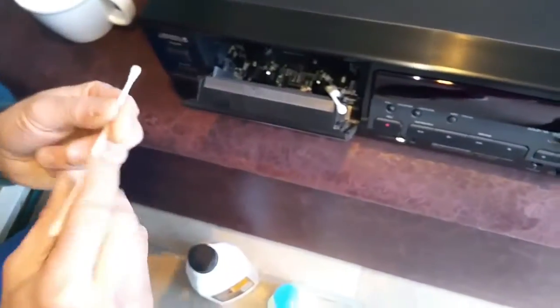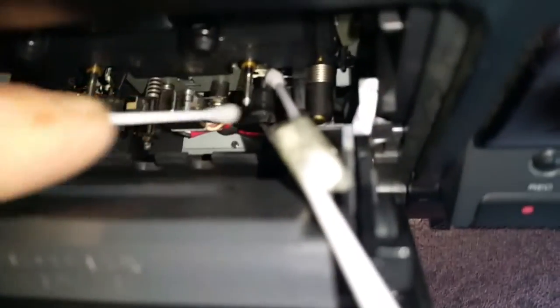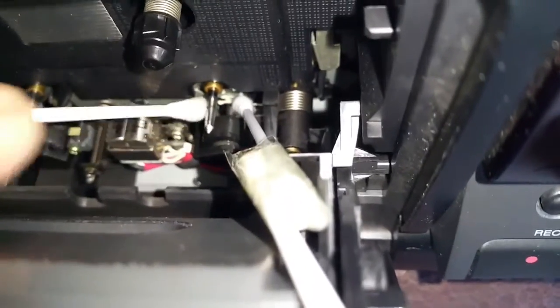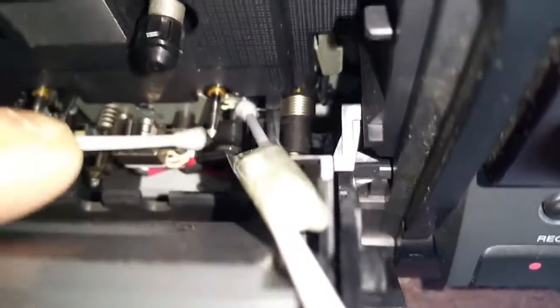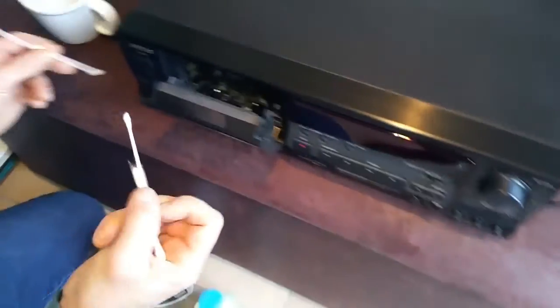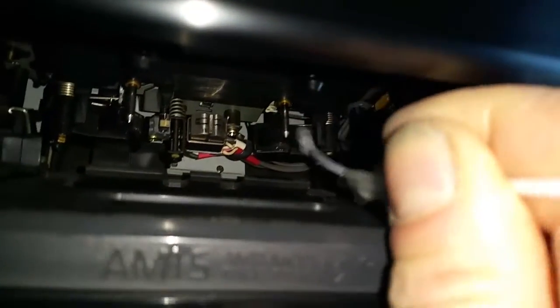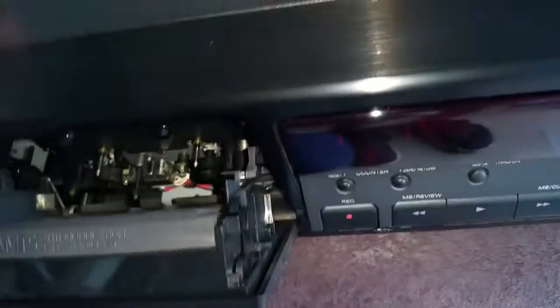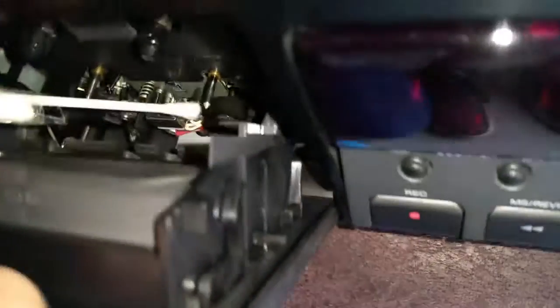You can see there's some dirty residue on the end there. This tape deck has probably been sitting around for a couple of years without being used. This is just part of the servicing requirements. This was one of the last cassette decks that were made. Right, I think that's done — now we're just going to dry it off with a dry cotton bud. It will evaporate on its own as well, but we want to try to get as much gunk off as we can. These pinch rollers are a bit more difficult to clean than the actual heads are.